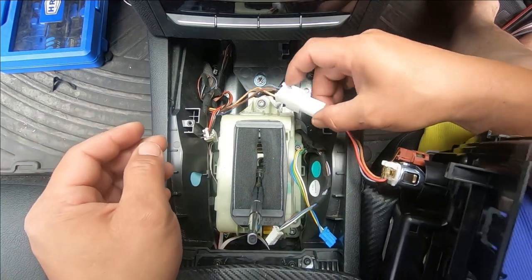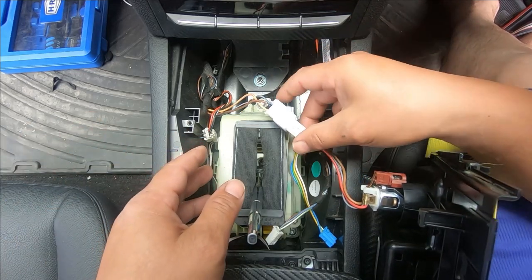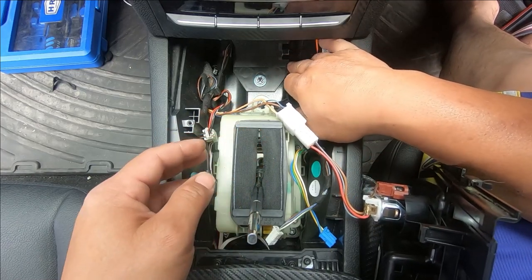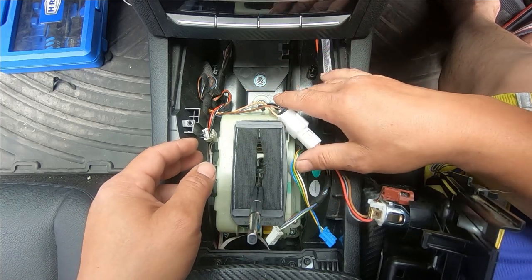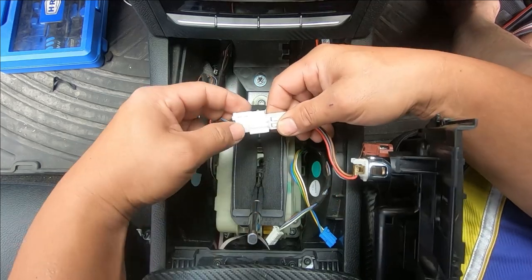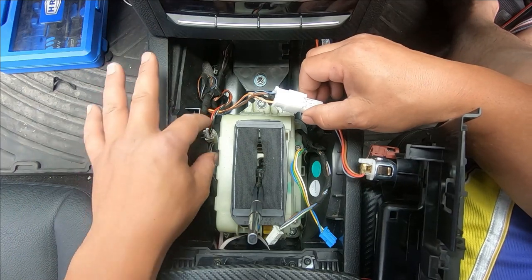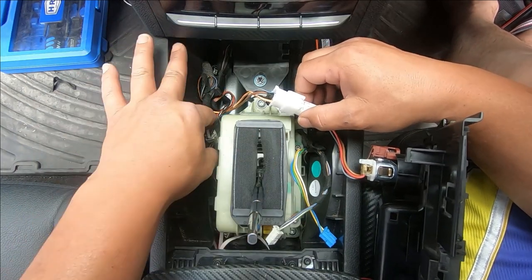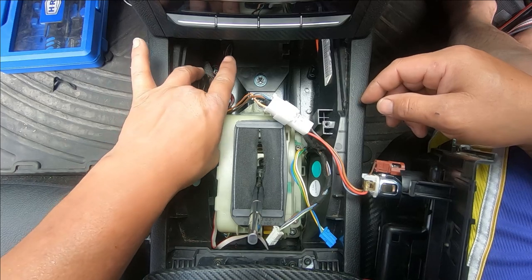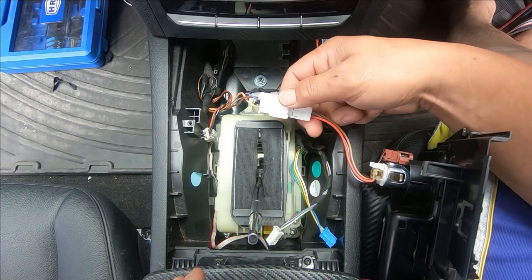In order to remove this, lift it up a bit, slide it out, push down on the back part as you slide it out. Now we need to disconnect the cigarette lighter plug. If your clip is still on here, all you have to do is slide it out — from looking at this clip it appears to be a sliding clip, very similar to how this smaller clip slides in and out and locks in.